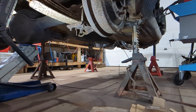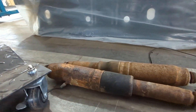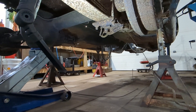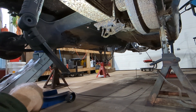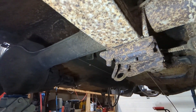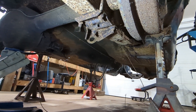Okay, well here we are again. I got the shocks out — that's pretty uneventful. There's an old set of air shocks in here. The nuts came off easy, just snapped right off — that's ideal. Had to pull them through the two holes where the air valve went. Now the other side came off pretty easy too, but it looks like it had been off once already because they have different nuts on that side. This one's pretty rusted though, so I'm going to give this a go.